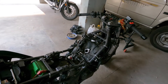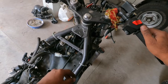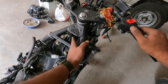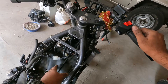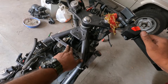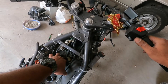That completes the spark plug replacement process. To summarize: the first thing I did was remove this flap, then remove this particular hose from underneath this flap. Then I removed the spark plug cap and folded the flap somewhat towards the front of the bike, since this flap is completely bolted and connected with the radiator in the front — so we cannot completely take it off. After keeping it there, I used a 16mm socket with its extension. That was a tricky thing, as you saw — this particular bar comes in between — but yes, it can be done. I inserted that into the spark plug position and turned it anticlockwise to take it out.